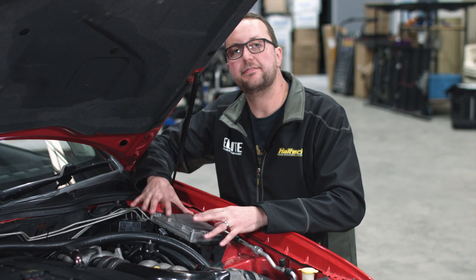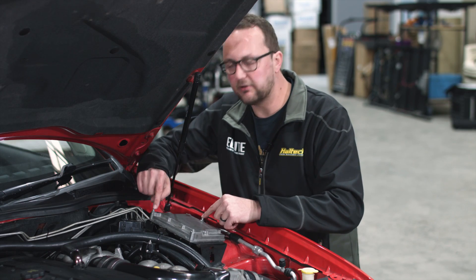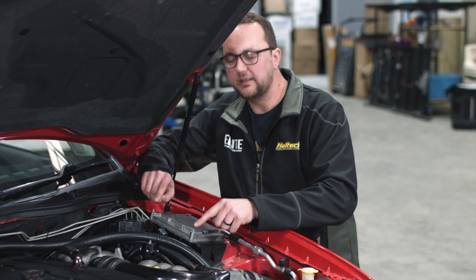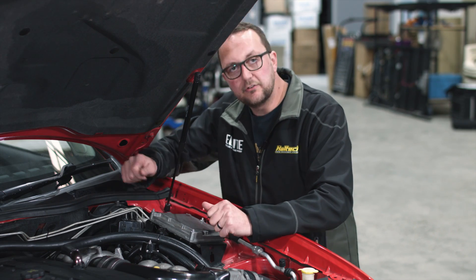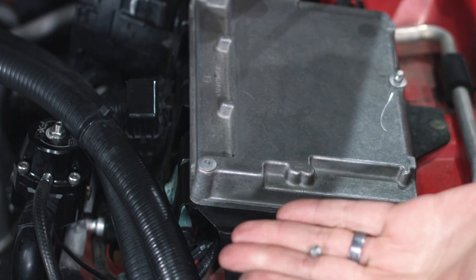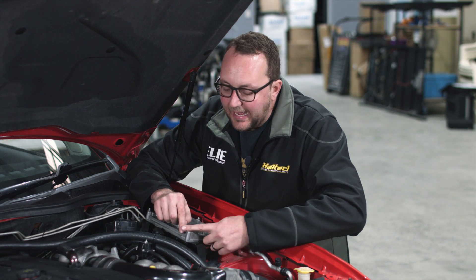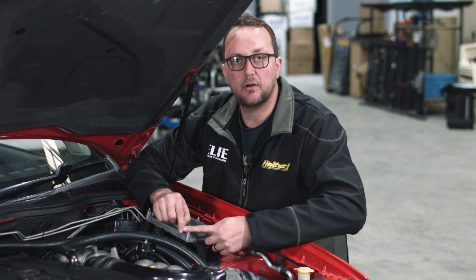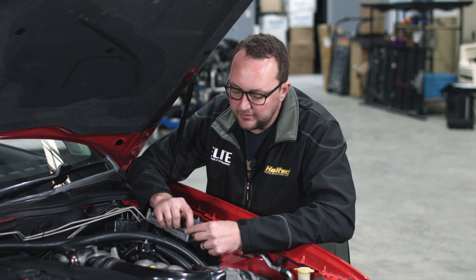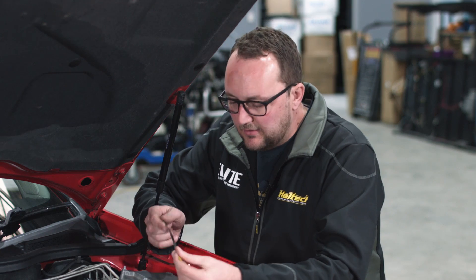The first thing we're going to do is remove the factory ECU. It's bolted down with three bolts which are actually shear-style bolts — when this car came out of Ford they put three bolts in and tightened them to the point where they shear off, leaving you with a flat head. In this example we've got the three heads sitting up so you can see how these bolts were screwed in. We're going to tighten them right up until the head snaps off, then show you how to pull them out. Once these tamper-proof bolts are holding the ECU down, there are a couple of methods to get them out: a pair of vice grips, a hacksaw blade, or a fine Dremel. Personally, I like to use just a little hacksaw — use my hand on the blade and gently go back and forward until I cut a slot where I can use a normal screwdriver, get in there, give it a bump and twist them out just like a normal screw.